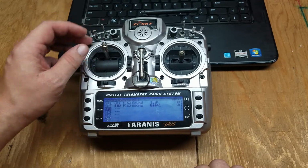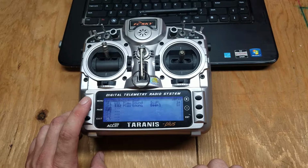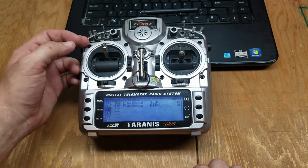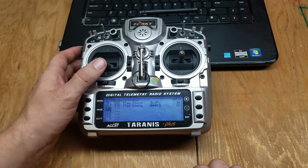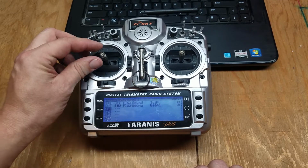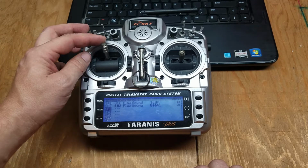So now, nothing's on. Above 75 for 5 seconds, a warning occurs. Come down, no warning. Above 70, warning goes off, saying the motor's too hot. Come down below, cruising around, say at like half throttle for a while. Beep lets us know that now our cooldown period has occurred and we can go back up to full throttle without worrying about overheating our motor.